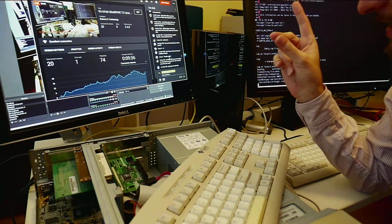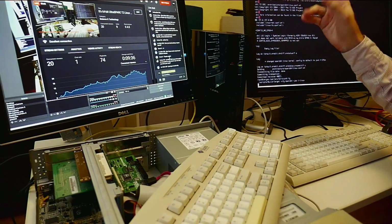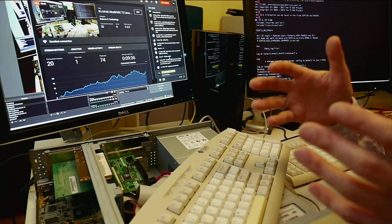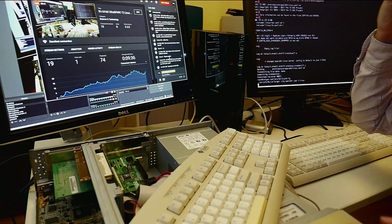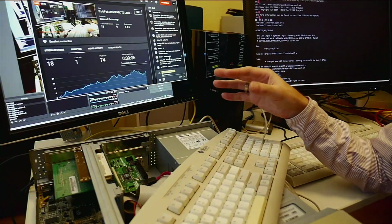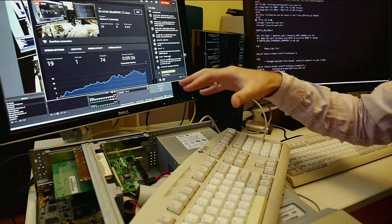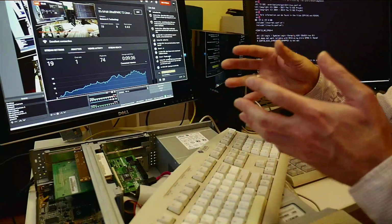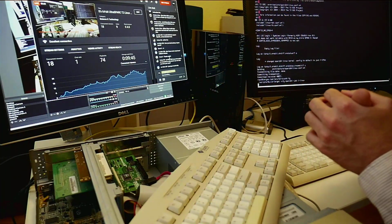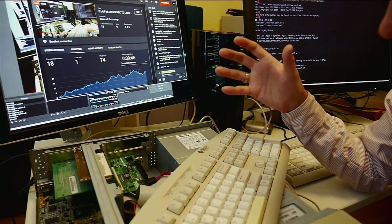And I think the Creator 3D stuff, the SST, didn't do much in hardware. It relied on the UltraSPARC. The UltraSPARC also has some visual instruction set. This is why I come back to that. Maybe you want to look this up in the meantime. This is some single instruction multiple data, and as far as I remember, the SST driver, maybe the Creator 3D doesn't do much 3D and just is a super fast frame buffer on some dedicated faster graphic port there on the UltraSPARC, and relying on the single instruction multiple data to do the 3D.